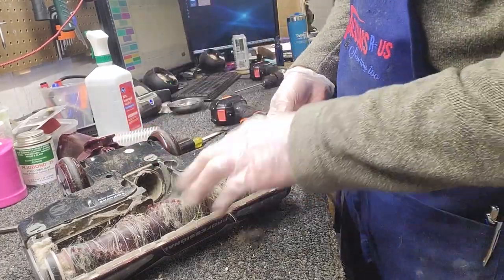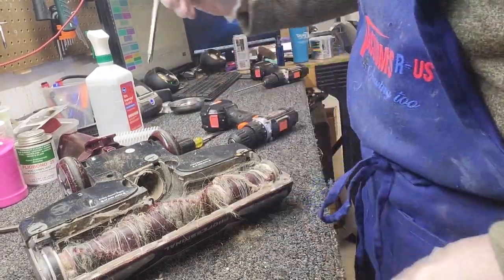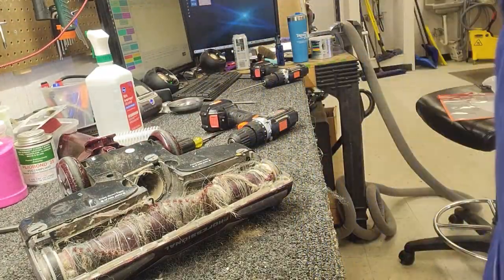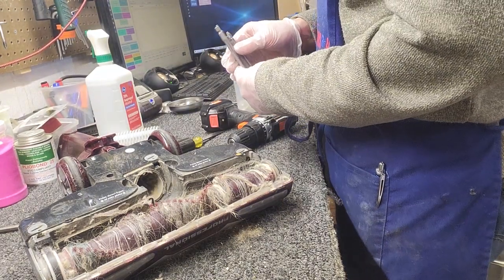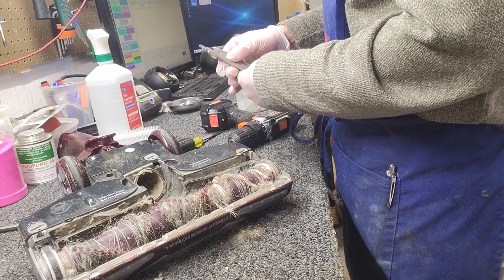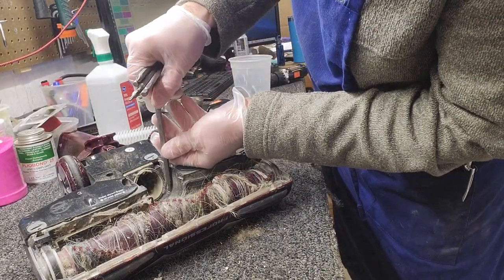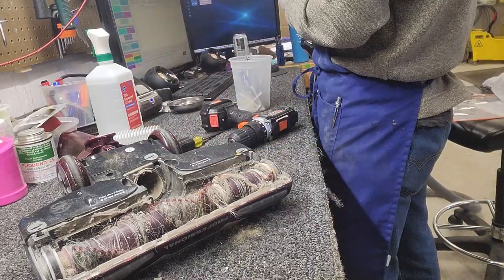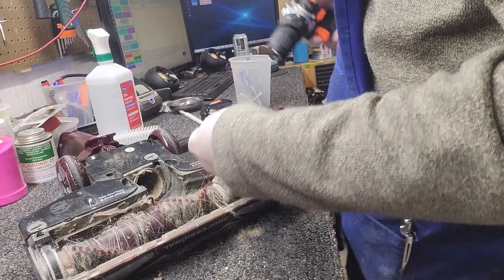In the center of the machine, holding down the clear cover, we have another small screw with a small head. Now we're going to take out the security bit. These bits can be a little tough to acquire — I'll put a link below. We sell a bit set which includes all of the various size security bits that Shark uses on all of their machines, so it's guaranteed to have whatever bit you need. This particular security bit on this model is a T20.